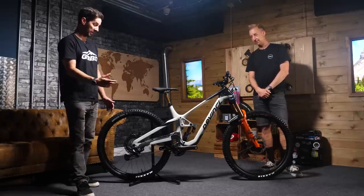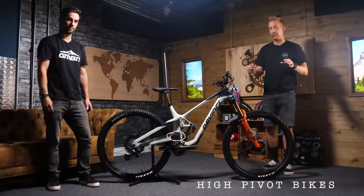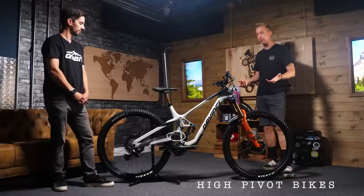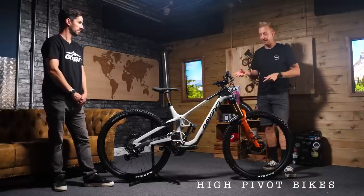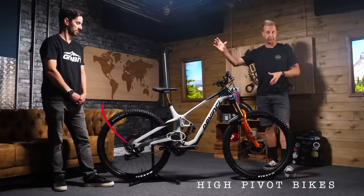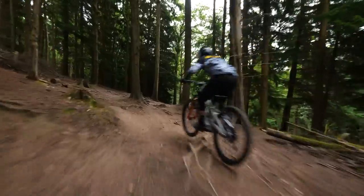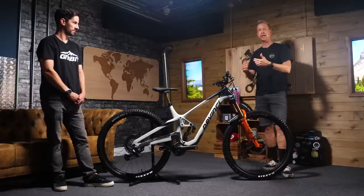The biggest difference you'll see from the old bike is, in fact, this high-pivot. So high-pivot bikes — bearing in mind that most mountain bikes have to pedal and are a best compromise — there always seems to be a lower pivot point. But by having a high-pivot point, your rear wheel axle actually moves backwards and around those bumps. Technically, on rougher trails, you're going to be faster when you're battering through stuff. The downside, though, is with a high-pivot, you get a lot of chain growth.